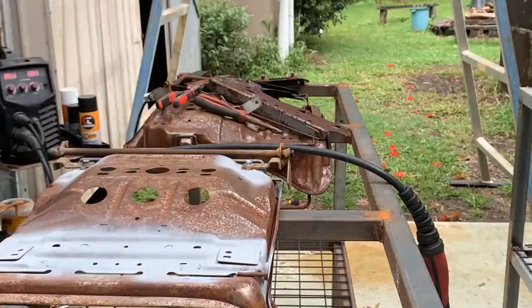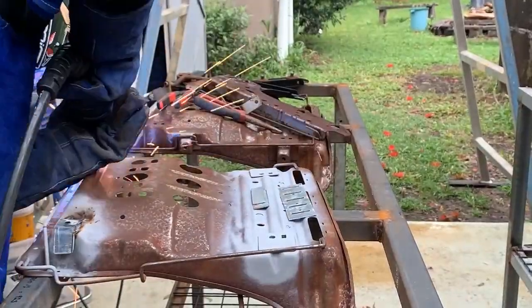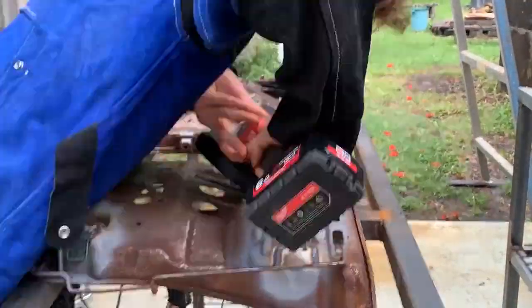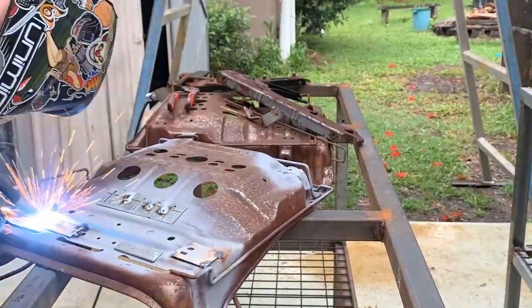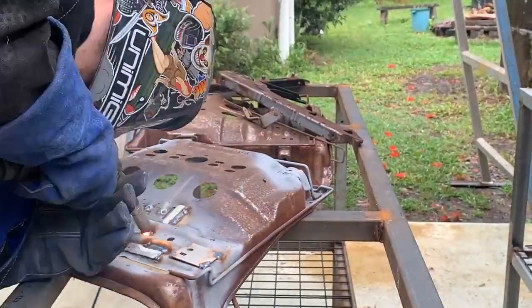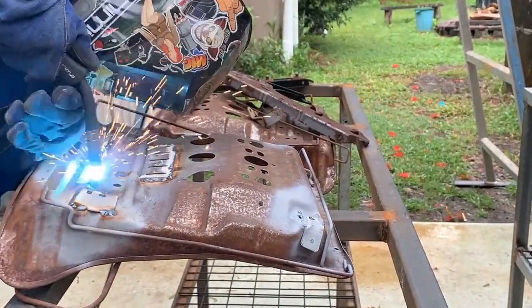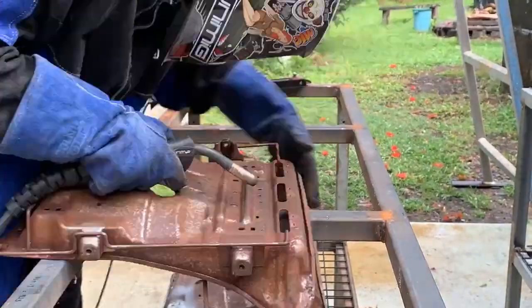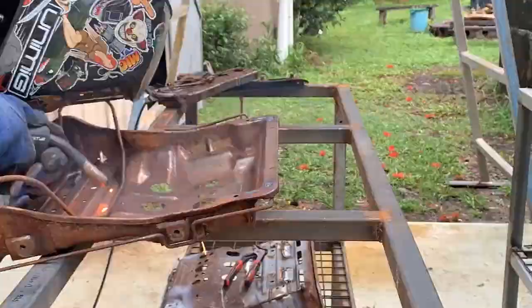And so with the stock reinforcement plates that came on these buckets, I've gone ahead and put more weld on them, or welded the entire surrounding of them, to ensure that there's no unnecessary silly movement because stuff wasn't correctly done in the beginning, essentially, because that's the idea, I think, is I want to do stuff correctly, or as well as I can, at least, as best of my ability as I can, from the very beginning.